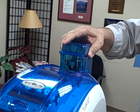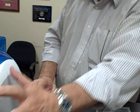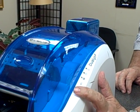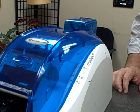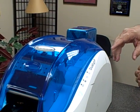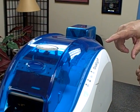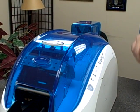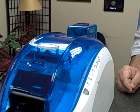Replace the card hopper with the cleaning card in it, and then you will push down on the power button for a half a second, just real quick, and let go. You will hear the printer cleaning the intake roller — it has not pulled the card in yet. Now it's pulling the card in and cleaning the interior rollers of your printer.